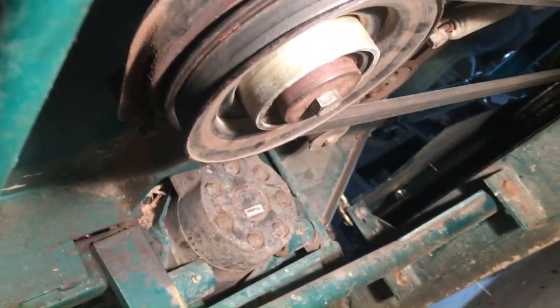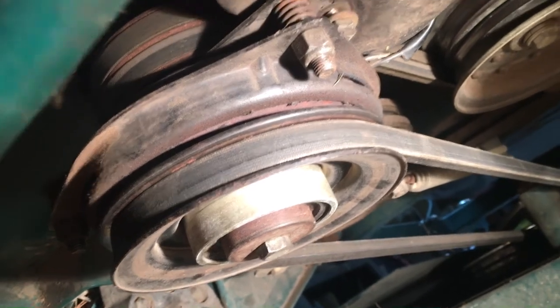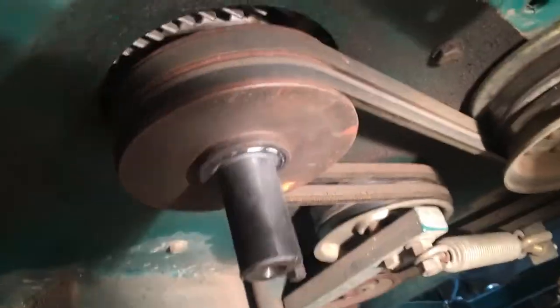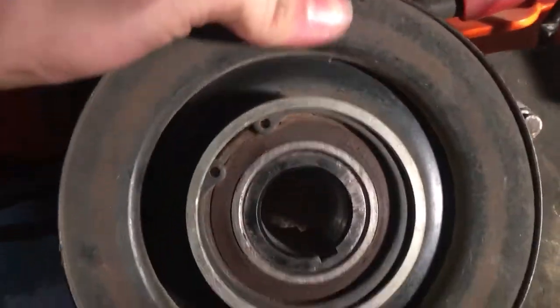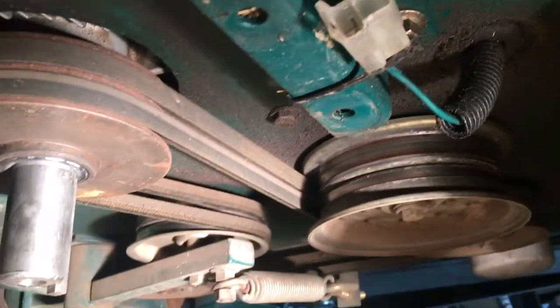But a really simple job. It's just got this little key crankshaft output and just slides over it real easy. The only thing that actually holds it on is the nut that goes on the bottom of this thing. And then you've got those two bolts that hold the deflector flap in place — that's just to hold the clutch steady while it's being used. That plug right there — the plug's hard to undo if it's old, and this will be a good time. If you haven't done it before, replace that, because that's kind of the main tension on this whole deal.